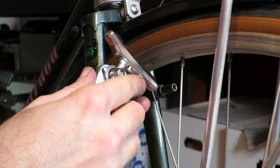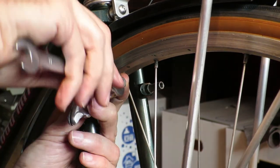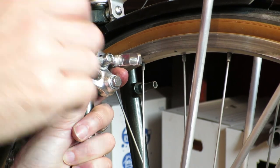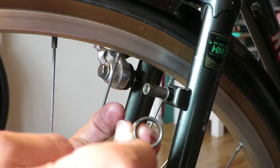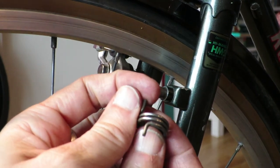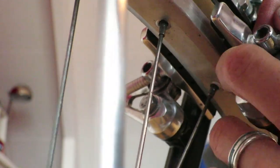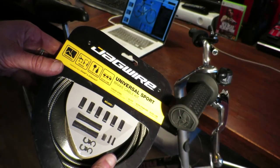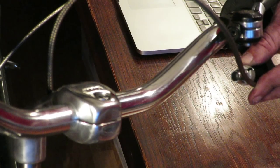You can see me moving clockwise for this left-hand brake arm, so the spring has to move clockwise for this one and counterclockwise for the other. Then I install the brake arms — there wasn't really any photo material I could use, but I made sure that the brake arms were symmetric.